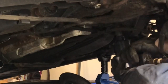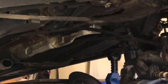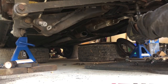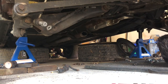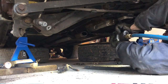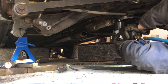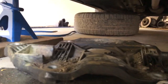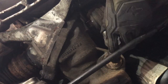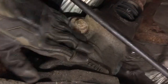What you see me doing here is removing the two handbrake cable brackets — that's necessary so you can fully drop the rear differential. I've taken the plastic differential cover off — eight bolts — and now the only bolt left holding the differential is the last one. I've got to loosen that last bolt and I'm going to need to support this as I lower it.